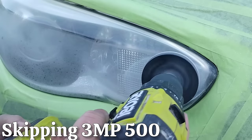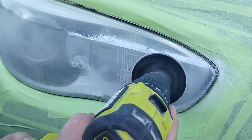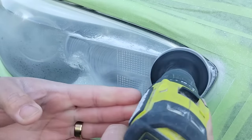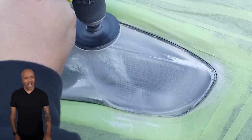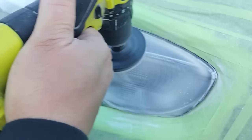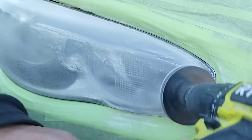This vehicle has one headlight that is this bad, and the other one is actually kind of good — good enough not to do a full headlight restoration on. I did it for next to free because the other one I just had to do a polish job on and give it a UV coating with something like Meguiar's, and it got most of the little blemishes out. I don't charge much for that; it's literally pennies on the dollar as far as time.